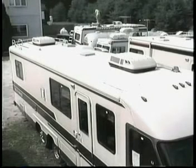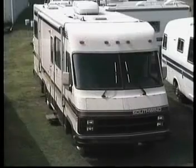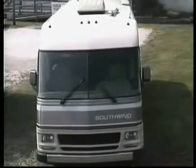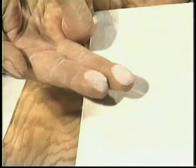Repairing or recoating sheet rubber is becoming more important in the RV market. Most manufacturers use white EPDM sheet rubber on new units. Although the sheet rubber is an excellent product, older units nearly always need recoating or repair, and white sheet rubber is designed to chalk. This not only keeps the surface cleaner, but also slowly erodes the thickness of the rubber and eventually exposes the black lower part.